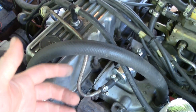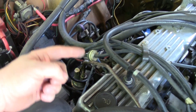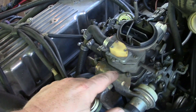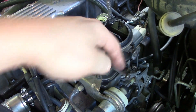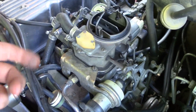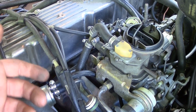The result is, when you go to start the car, because we have a mechanical fuel pump and it doesn't pressurize itself like a fuel-injected vehicle does, you have to crank and crank and crank, because now you have to pull fuel back from the tank through the fuel pump, through the fuel filter, and fill the bowl of the carburetor. Then you have to purge the main idle jets and circuits inside of the carburetor. And if gas has been ejected into the manifold, you may even be flooded — you can have a lean mixture preventing carburetion and too much gas in the manifold at the same time. That is vapor lock, and it just happens after about 10 to 15 minutes of sitting with a hot engine, because once you stop it, your engine will hot soak.